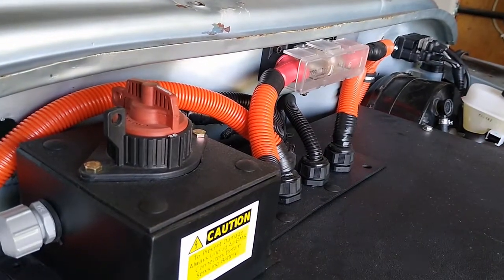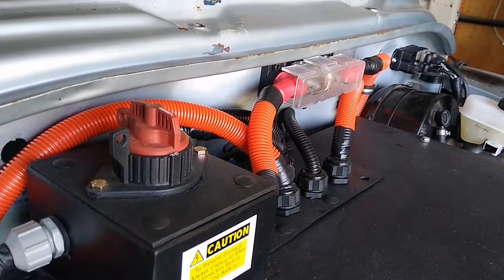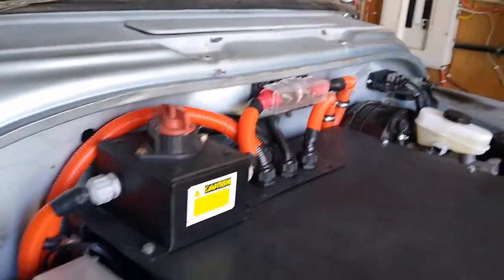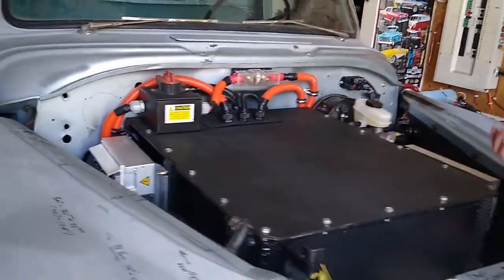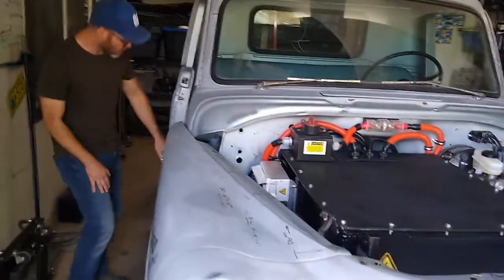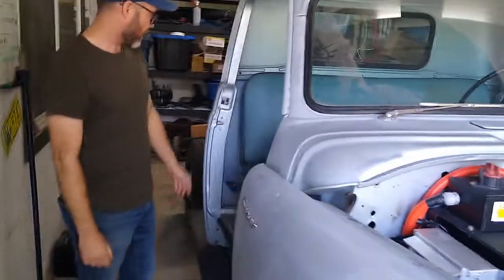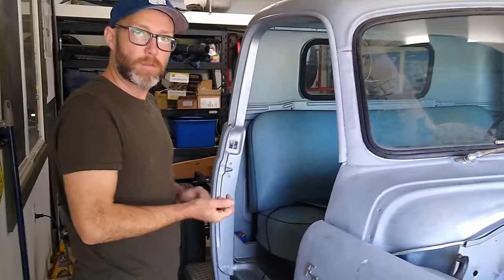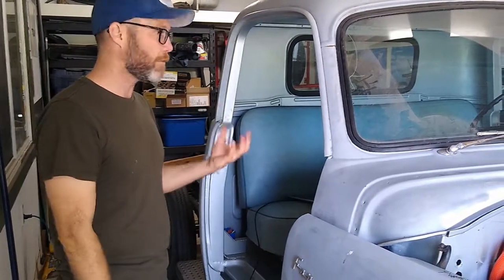All the orange cables run down through my contactor box and into my controller, which I just set up yesterday. One of the cool things about this setup is I've got the Orion 2 battery management system, which monitors all the temperatures and voltages of the battery and controls when the charger comes on and off. It's conveniently hidden away underneath the seat, with all the wires running along the chassis underneath the truck. The BMS also balances the battery cells — you want all cell voltages to be roughly the same within a very small tolerance so you get the full capacity from your battery bank. Generally they should be about 3.3 volts.